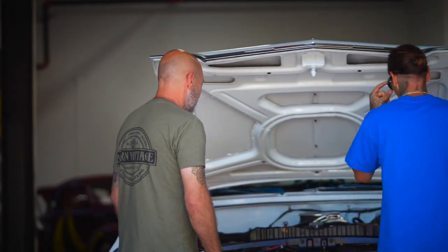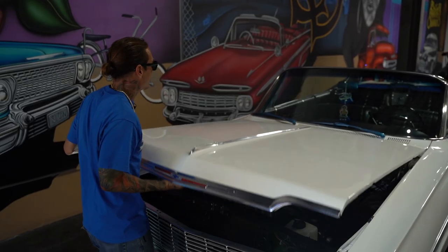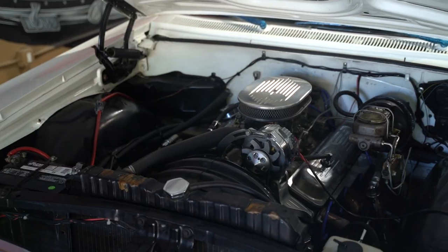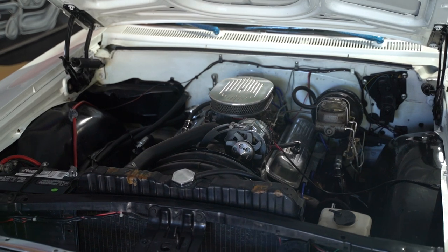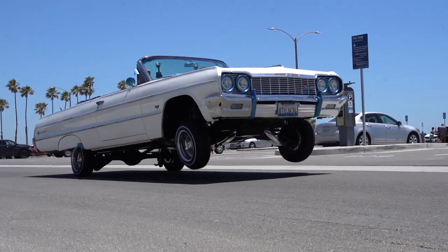I changed out the suspension in it. I added a two-inch tuck uppers and lowers. It had a 350 when I got it, so I basically just tuned it — changed the plugs, tightened up some stuff. It even has the old original radiator in it with the fan. I usually go with the Champions upgraded aluminum radiator, but this is working.